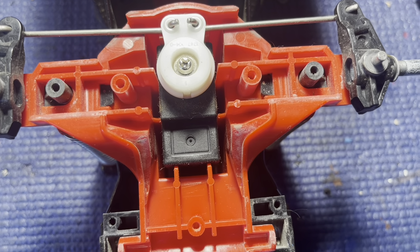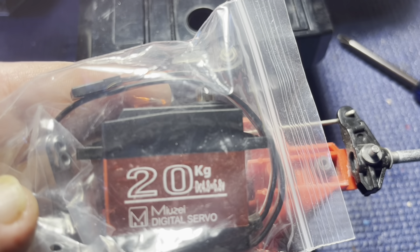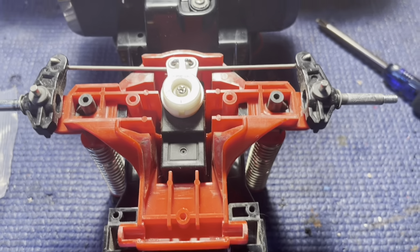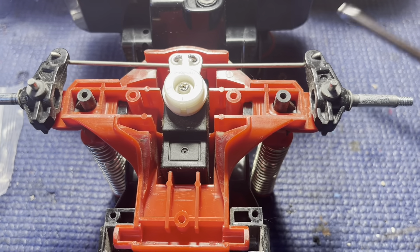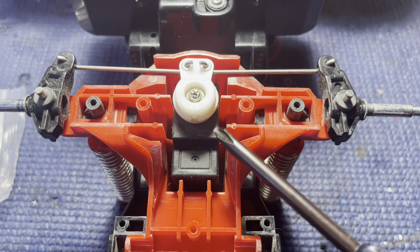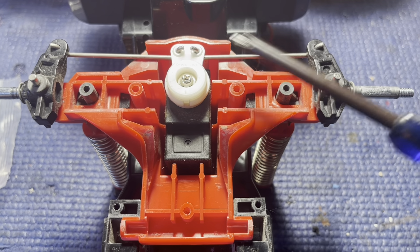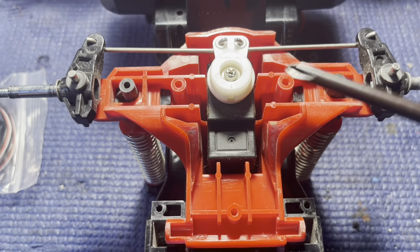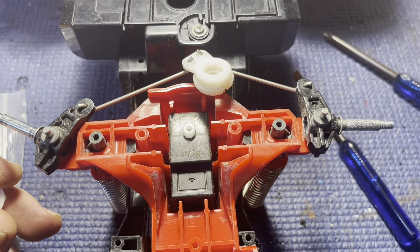You can see this five-wire servo is a little different than a normal servo. Normal servos have a basically flat top, but this one is L-shaped. The Radio Shack ones made by Taiyo are the same way — I'm pretty sure these QD trucks were made by Taiyo for Tamiya, just made to Tamiya spec, so they're a little better than the originals. Anyway, you cannot use the original servo saver because the end on the servo is different, so you've got to pull that out, then reuse the rods with the new servo saver. You've got to cut the ears off the servo to get it to slide in.